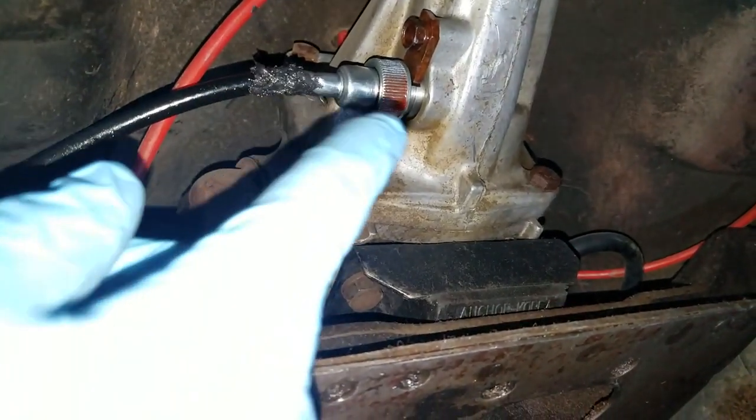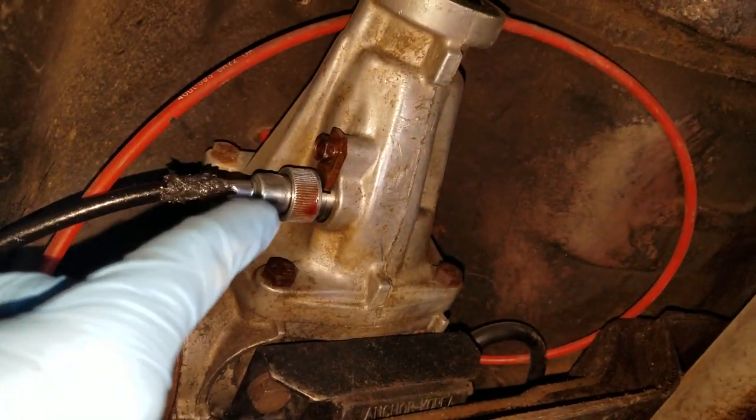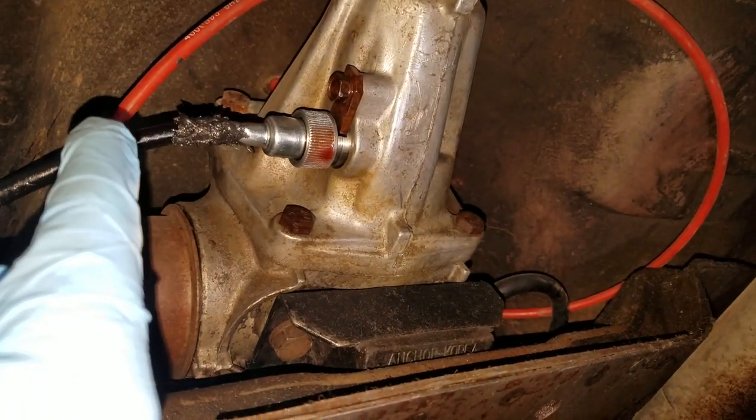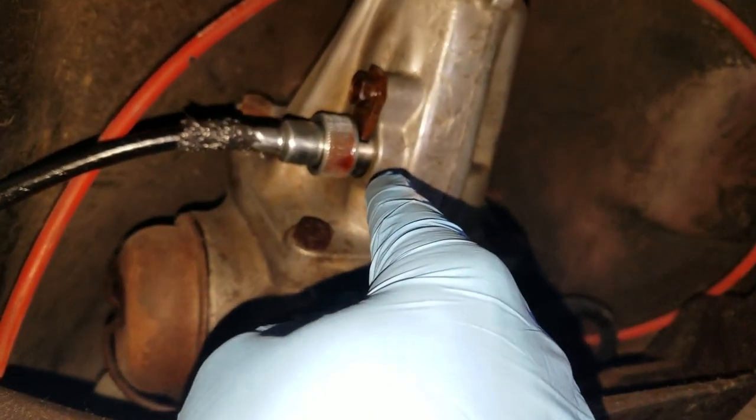The gear's new, the bullet's new, and the speedometer cable is new. However, the speedometer cable itself doesn't stop fluid from coming out — it just screws on there. Everything is brand new and it still drips. The car's been on jack stands for about a year, just constantly dripping into pans under the car. I don't even know how much transmission fluid is left. The transmission shop I talked to said the seal inside the bullet sometimes doesn't get tapped in and seated all the way.